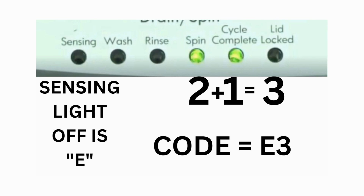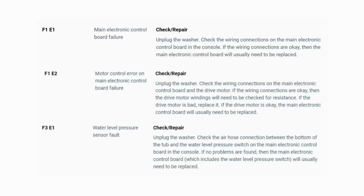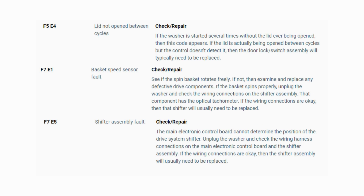That's one code. The same error code flashes repeatedly until you turn the dial one click clockwise to show the next error code. Turn the dial again to see if you have any other codes; if there are no more codes, then you're done. To exit diagnostic mode, turn the washer off. Now you have your error code — use the images in this video, look in your washer repair manual, or just Google 'top load washer error code' and enter the code. Now you know the problem. It's time to find the parts needed fast and cheap — watch our next video for the quick tutorial on how to do this.